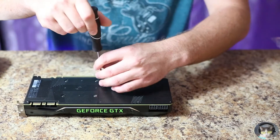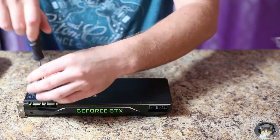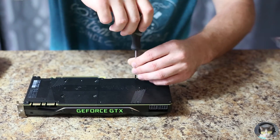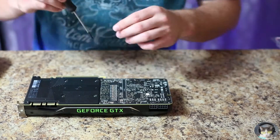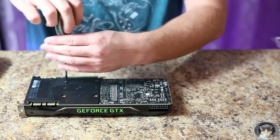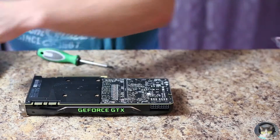Just removing the back plate here - there are a numerous amount of tiny screws. I was baffled by how many there were. There were several times I didn't notice one or overlooked one briefly. They are very small, but they were very easy and simple to remove. The back plate is off - there's a little thermal pad on the back of the card. Now going back to removing the GPU core screws that hold the aluminum heat sink to the card.